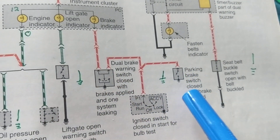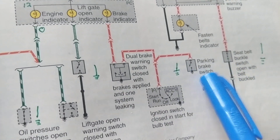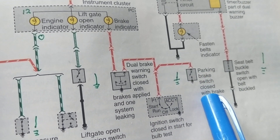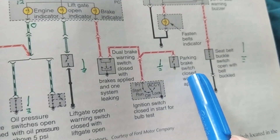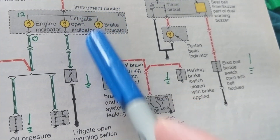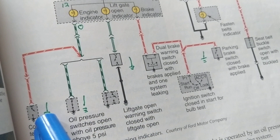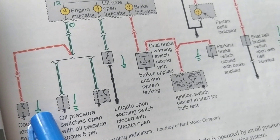For the parking brake: if you left the parking brake on overnight and start the car in the morning, the brake indicator tells you it's engaged. It knows because the parking brake switch is in the closed position, providing a ground path. The bulb lights. The key question for all these systems is: when is the switch open and when is it closed?